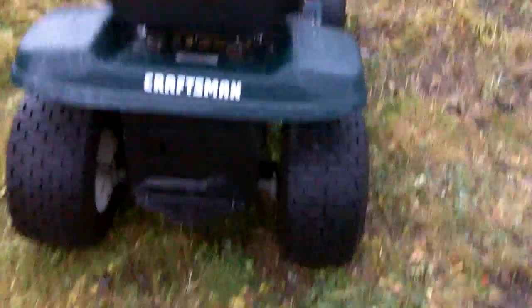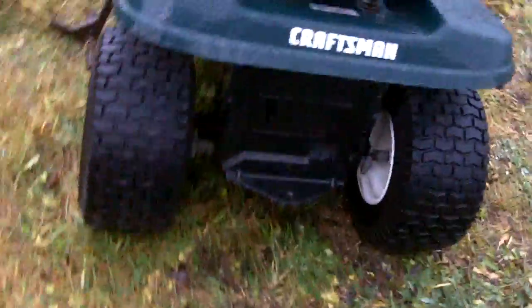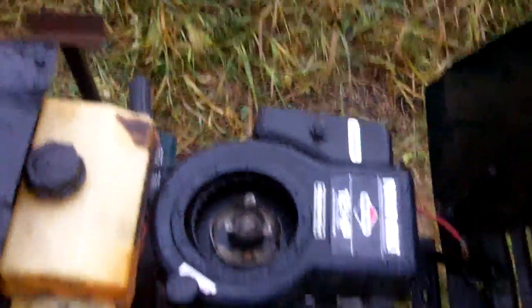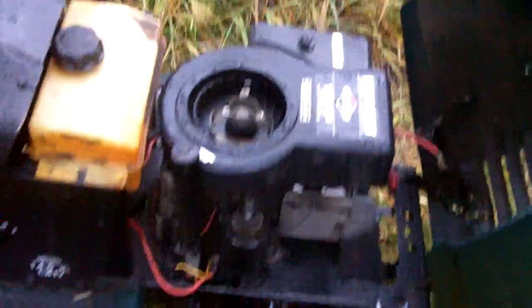I found out I've got the opportunity to build a go-kart in my tech class, so I'm obviously going to jump at that opportunity. Right now this is your average run-of-the-mill lawnmower, but my plan is to use it as an all-terrain base. I'm going to put a live axle kit on the back and put a horizontal shaft engine in there. Right now I've got a 12-horse Briggs in there — it just needs the carb solenoid bypassed and it'll run.